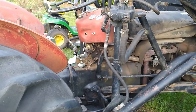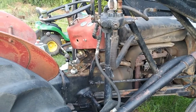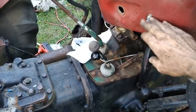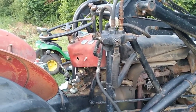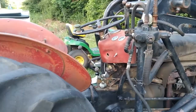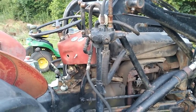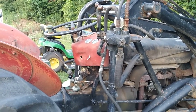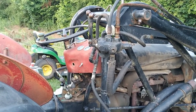It's running. Had to do a lot of fixes to it. The wiring was one thing; the starter needed work — brushes and everything on that. The carb was dumping gas out once I fixed the wiring. Then come to find out it's supposed to be a 6-volt, but it wasn't — somebody converted it to 12-volt with a 12-volt generator at some point. Luckily the guys at NAPA took the 6-volt battery back and swapped me out for a 12-volt.